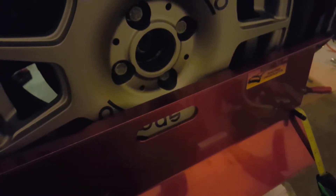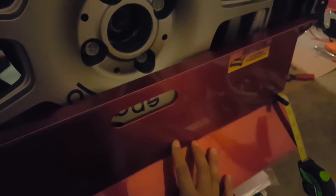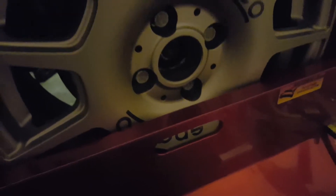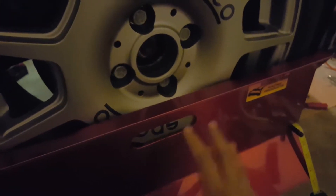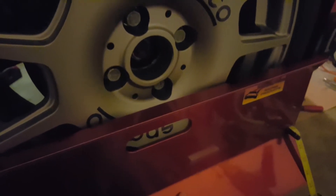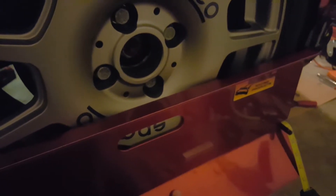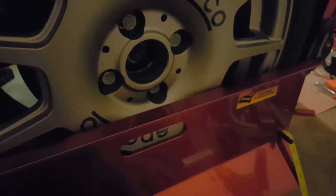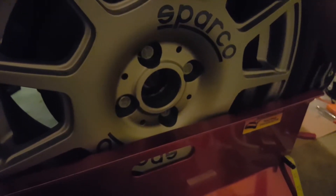Now that is just an overall measurement — I haven't even adjusted this wheel yet. If you're not aware that this is just an overall measurement, kind of a gauge of where you're at, you might be inclined to start adjusting both ends arbitrarily trying to correct it. I'm actually going for 1/16th of an inch per side, which will give me 1/8th of an inch toe in overall, which helps a little bit with stability.